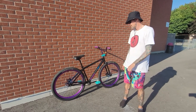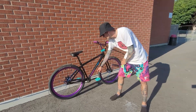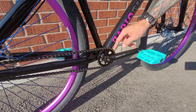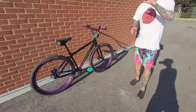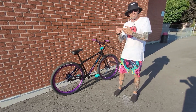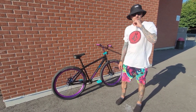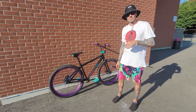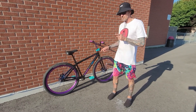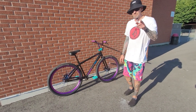My part update installation video did not go exactly as hoped since the 23-tooth sprocket doesn't fit the chain ring properly. The pinch bolt goes through and holds the sprocket to your crank arm — the sprocket just sits on there, it's not splined or attached to anything. The 23-tooth just doesn't stick out far enough for the bolt to engage. I don't know a ton about BMX bikes. If you know of a way to get the gear ratio using a smaller sprocket in the front or larger than 12 in the back, let me know in the comments.